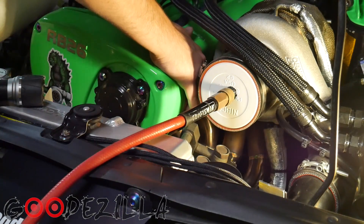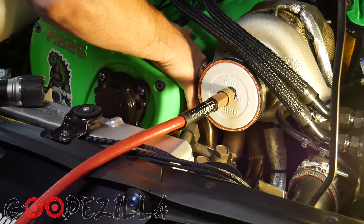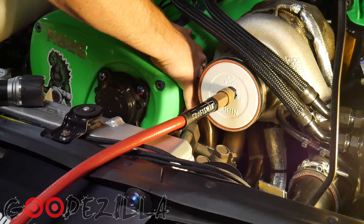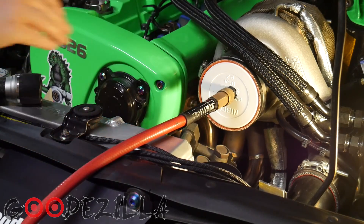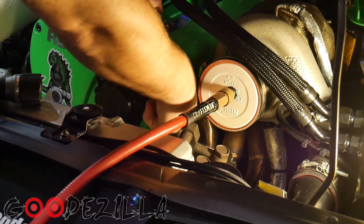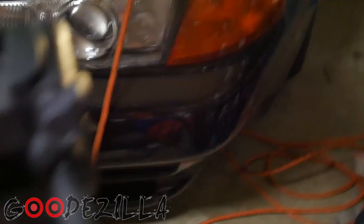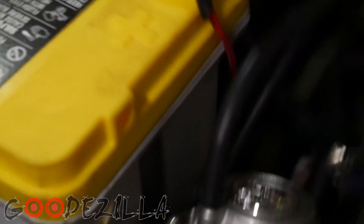It's this port right here. Right away there's this one right here. It sounds like I have a boost leak coming from somewhere down in the fender well where the piping is. I can definitely hear air coming out. Found us a boost leak.